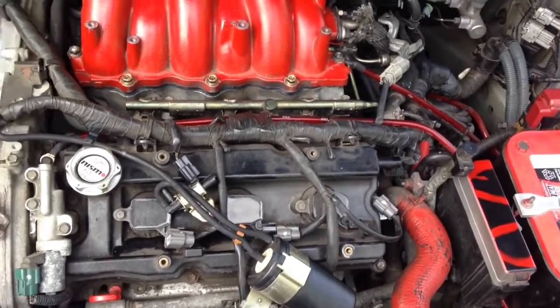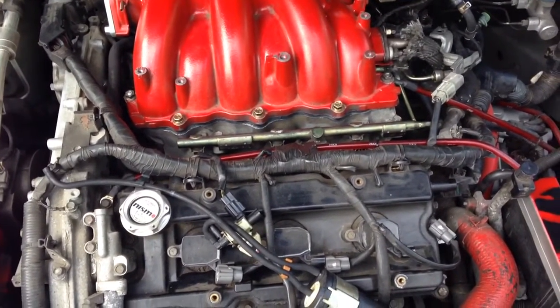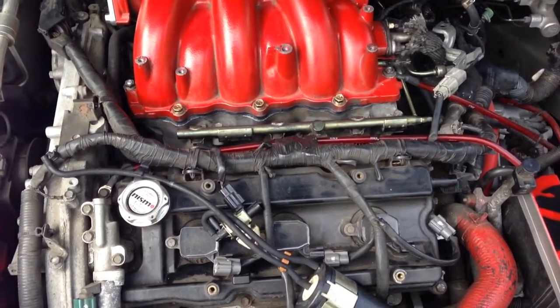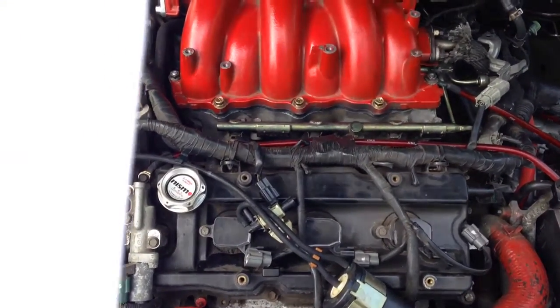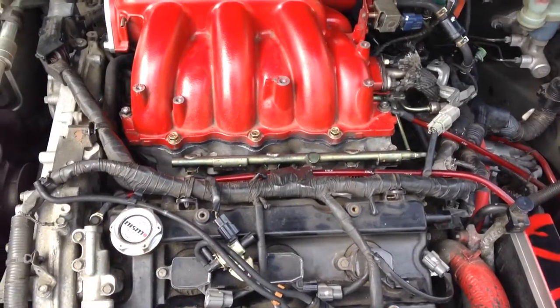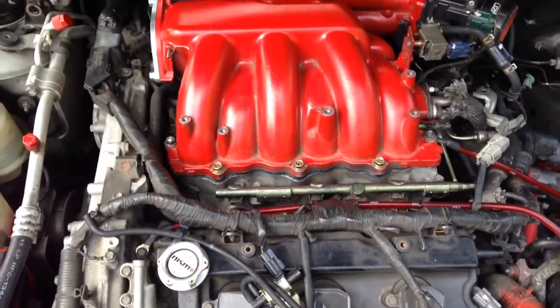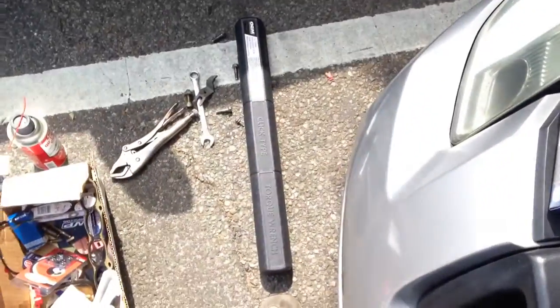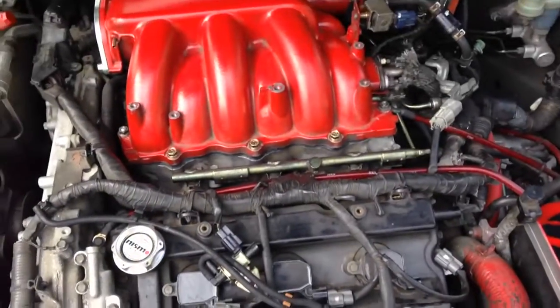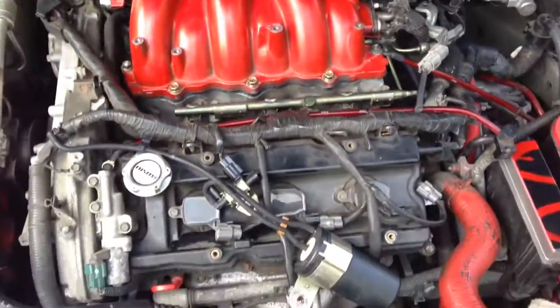And the proper torque on that is supposed to be 13 to 15 foot-pounds. So just check that, make sure everything is good, double check it, want to give y'all the right info. So 13 to 15 foot-pounds, got that in already. Trusty torque wrench. And yeah, got the spacer in the back. So let's get the rest of this hooked up.